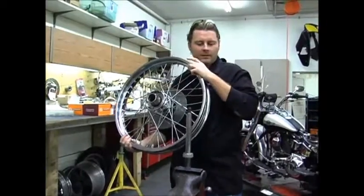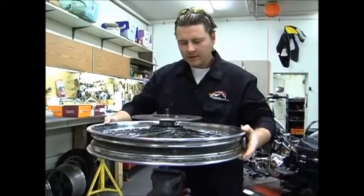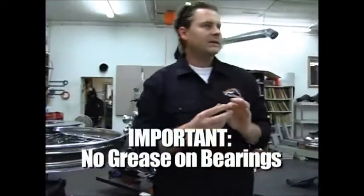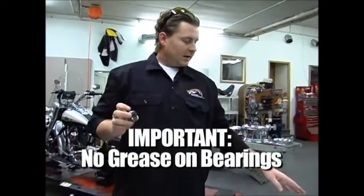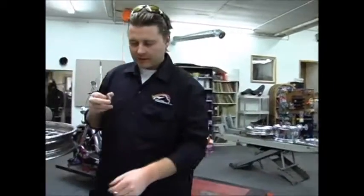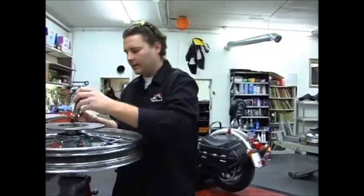The seals are out, and a big point to make here is there's no grease — that's a specification by Harley and the industry. As I go through this you'll see where I'm using the manual. You do your checking with no grease in it; that's really important — you want to clean it out as thoroughly as possible. This is obviously all disassembled; this is what your center spacer looks like.